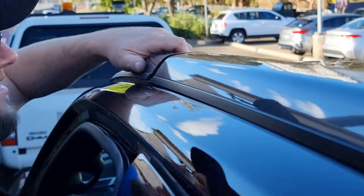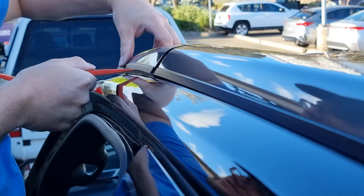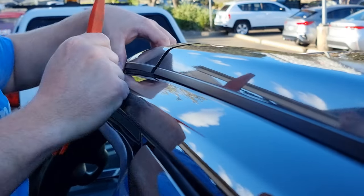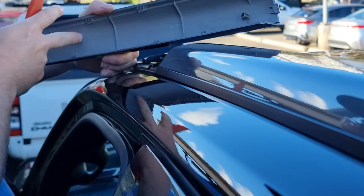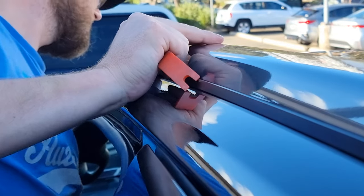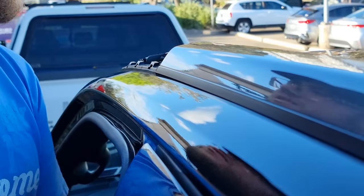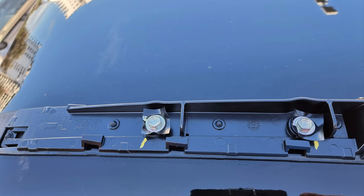What I'm doing here is removing the roof rails. You want to start by popping off the four corner covers by sliding a trim removal tool under them, and hinging them back towards the roof rail. The hooks underneath the covers you just want to pop away, and then slide the cover back up. Once you've exposed the bolts, you can undo them and remove the roof rails. There are two bolts in every corner.